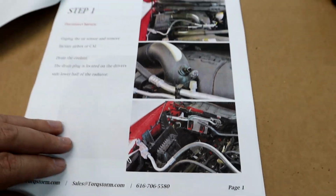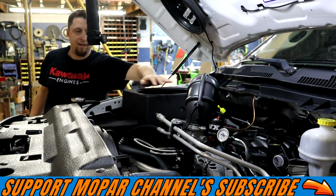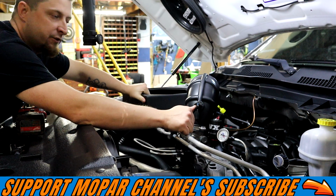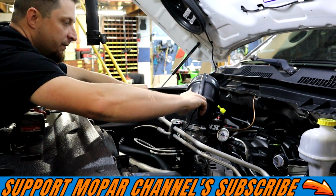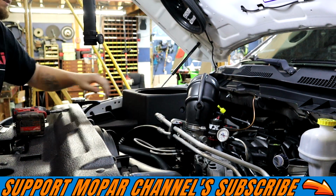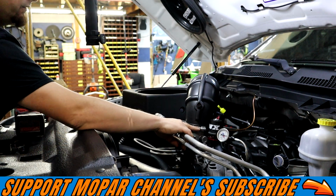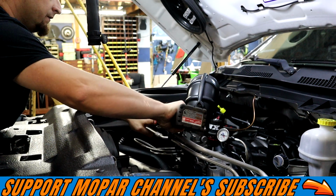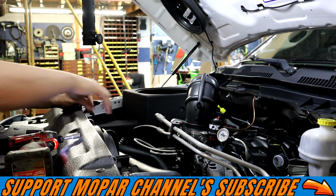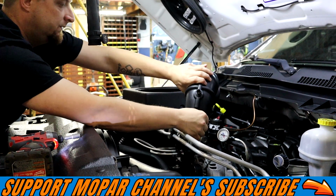So let's go get my Mopar intake off. Alright, so we're going to get this big Mopar cold air intake out of here. And your IAT sensor plug is right here, so you're just going to pop the little red clip, press the button, unplug that, and we'll just let that lay to the side. And there's a 5/16 screw clamp right here. We're going to get that loose. And then that tube pops off.